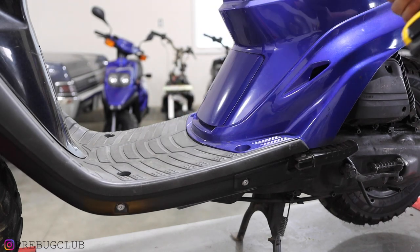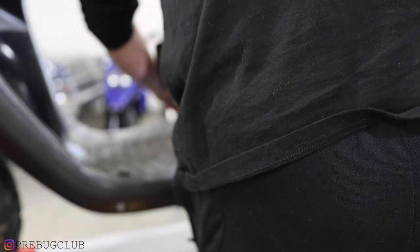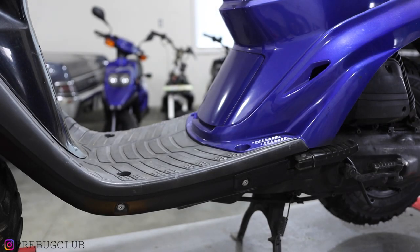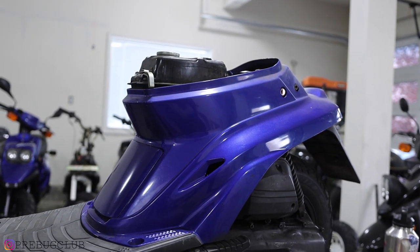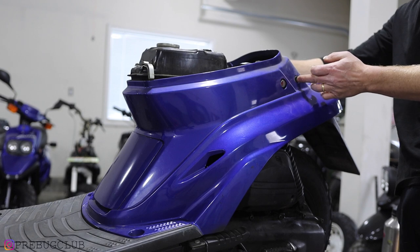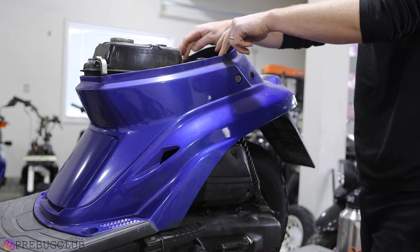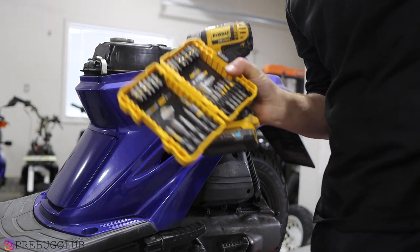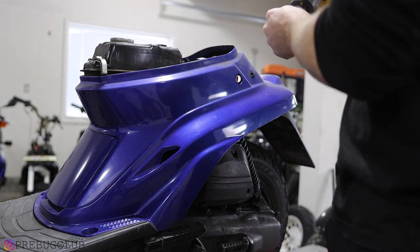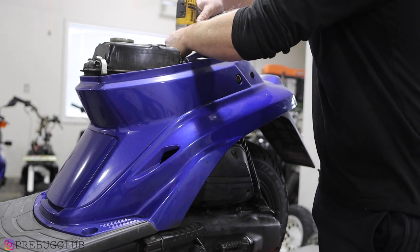Floorboard — bolts are 10 mil. This rear fairing can now come off. You want to be careful because of the lugs on the frame here — a lot of times you'll see weak points. Almost forgot — there are two Phillips tabs on the top frame.